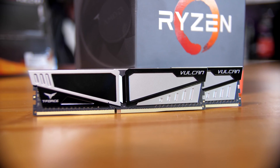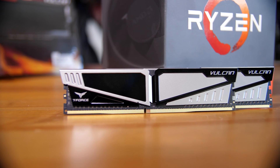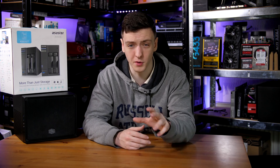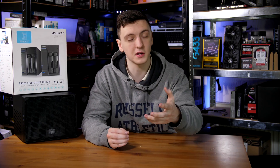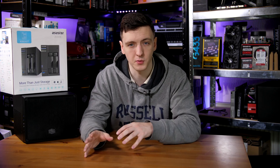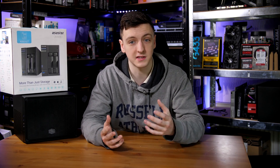Next up is choosing your RAM, which is pretty important. FreeNAS uses the ZFS file system and that uses a lot of RAM, especially with large capacity drives. In the four-terabyte-plus range, I'd recommend at least 8GB, if not 16GB of RAM. For something in the 30TB range, go even higher. You'll want to prioritize capacity over speed here. If you can pick up ECC memory, that makes for a pretty reliable server — most AMD Ryzen motherboards do support ECC, but do check your specific board.